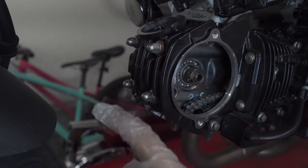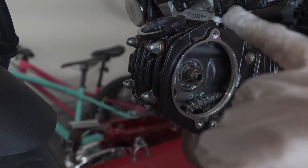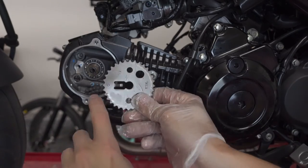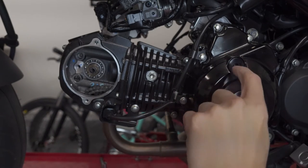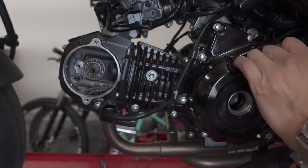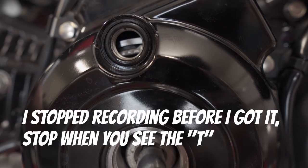No need to loosen the valves to get this out or back in, although I will check to make sure the different height of the lobes doesn't require me to adjust the valve. Before we throw the gear back on, we need to make sure that everything is timed correctly. We need to get the engine to top dead center so that we can align this little circle with the mark on the front of the casing. To do that, we need to take off these two little peephole covers — the bigger one is a 10 millimeter Allen wrench and the top one is a 6 millimeter. I'm holding the cam chain with my left hand so that it doesn't get sucked back in.